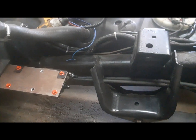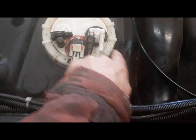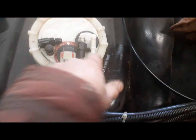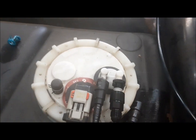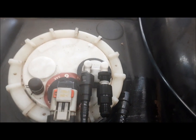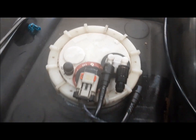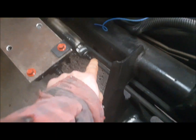I'll show you how I'm doing it and what I'm using. This is the suction line that goes up to the lift pump at the front. So we've pulled that off the sending unit and now we have to put an adapter on it that will adapt this to AN. Lots of different companies make these — this one is a Russell. I've used them on my race cars. That little horseshoe-shaped guy goes on there behind the barb, and then this piece, the actual adapter, has got an O-ring in it to seal against there. You just push it over and screw it together and we've now converted this to AN.